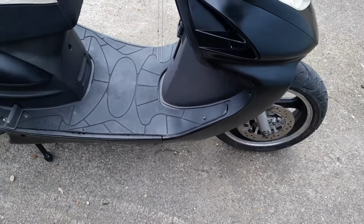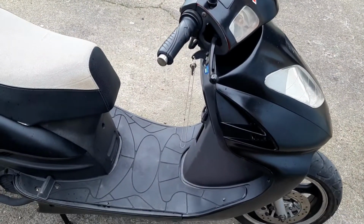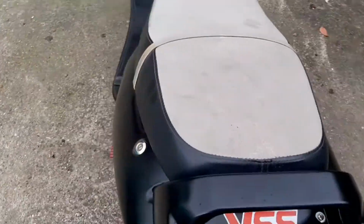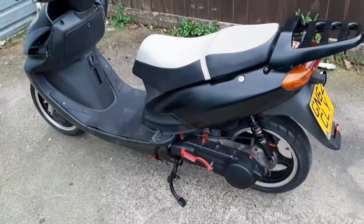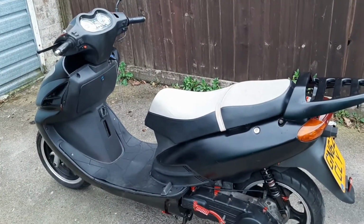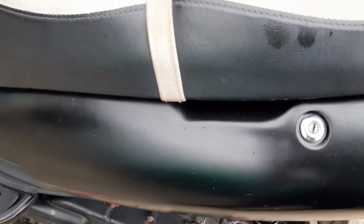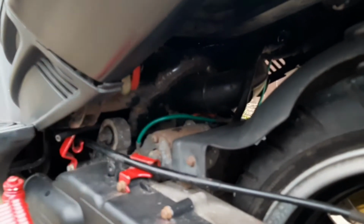And besides that, I think that's everything I've done to the bike so far. Oh, I also did near enough a top end rebuild, just as a side note, because when I first got it, it would start and then it would splutter and then it would die. So I decided to redo all the air intake. It did have a split intake manifold. I would show you underneath, but I'd have to take the seat bucket out really. You can tell the starter motor's all rusty and horrible still. That needs going over, and I also want to get in there and maybe respray the bottom of the frame. But I don't know, that's all future stuff.